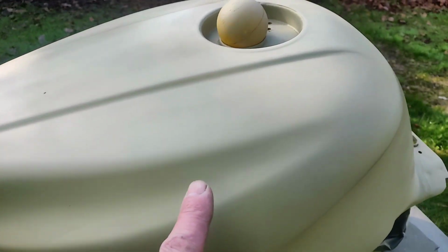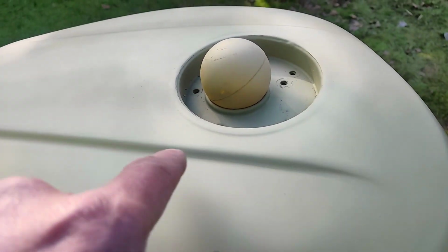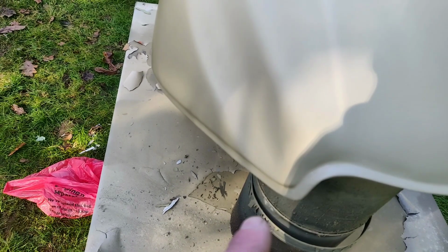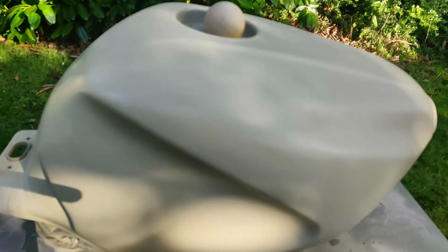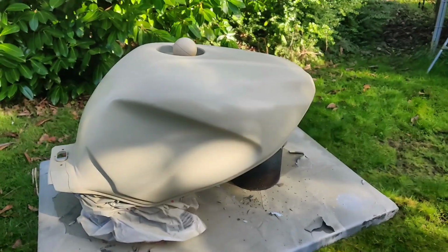It's a bit scratchy. Kind of holes up there. A bit of scratching across there, which I hadn't noticed before. I may just high build and see how I get on with that. So the only bit I really need to have a play with again is just on that front edge. And actually, yeah, I'll let it dry, give it a quick go, and then we'll go hammer and tong over the top, see how we get on. I mean, you shouldn't use paint to fill scratches, but I think we'll get away with what we've got there. Right, cool. Let's let it cure.